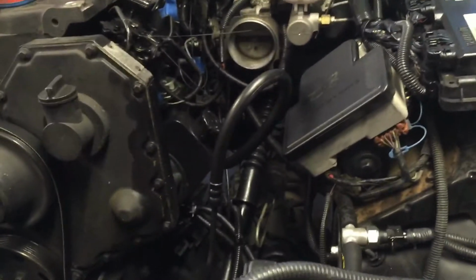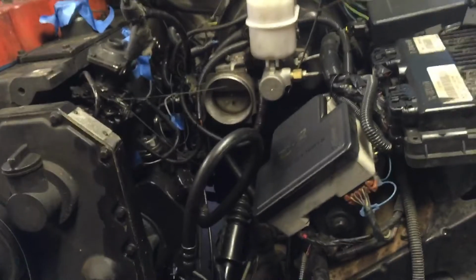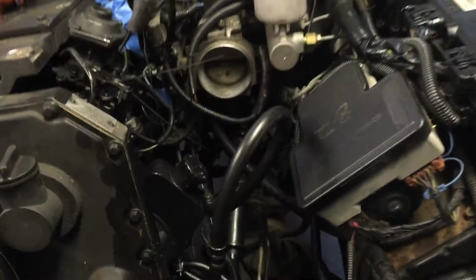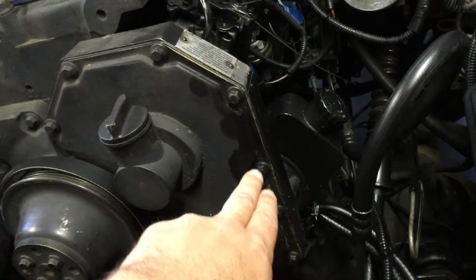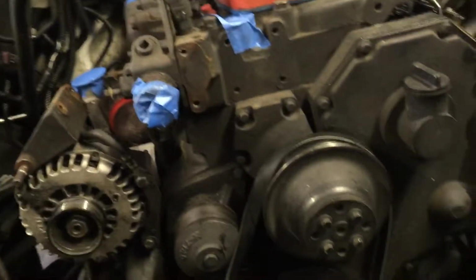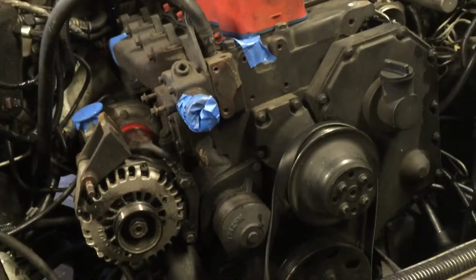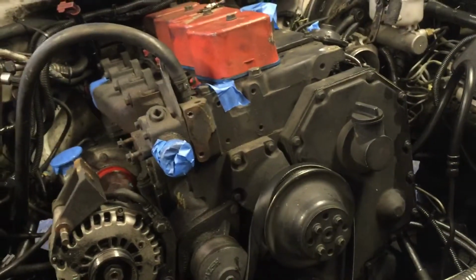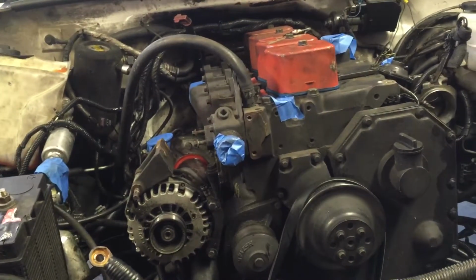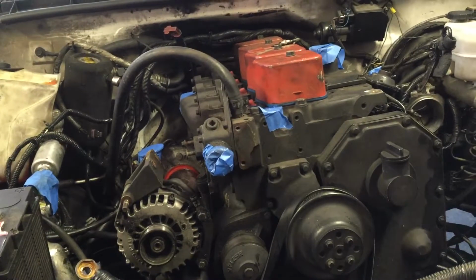Any type of smell that would happen at a stoplight coming from the blow by, it was gone. But I don't know if that built up too much pressure, having that tube extended, because after that happened, I noticed it started getting some leaks right here. And it might have been the cause of the head gasket. I'm not quite sure. It could have been weak from the go. It could have been a combination of a few things. I honestly don't know. It kind of upsets me because I'm going to replace it, but I can't stop it from happening again if I don't know what it was.